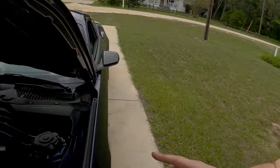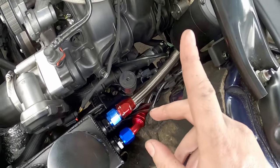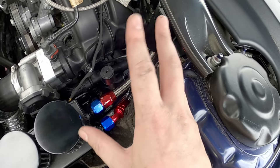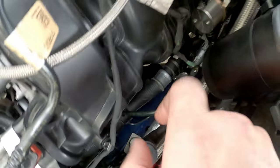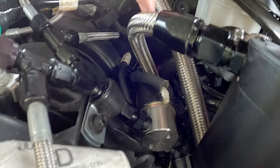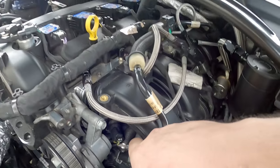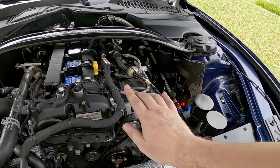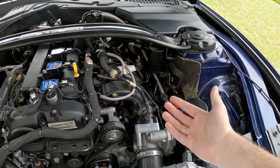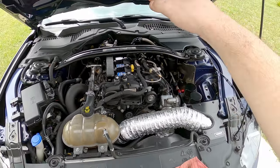This is actually taking me a lot longer than I thought. It's not my best work because there are some quirky things going on I'm not super proud of, but if it fixes the problem of gassing myself out, I'll be happy until I find a better solution. As you can see, the other line runs down — there's a T-fitting back there coming from the baffle, the other line from the T-fitting comes up to the input of the catch can, and the catch can runs out into the manifold just like it was.